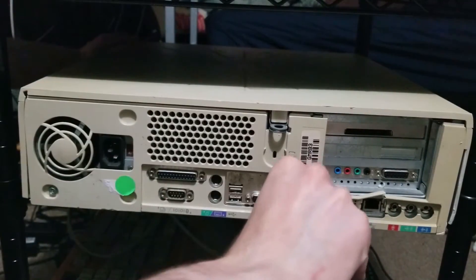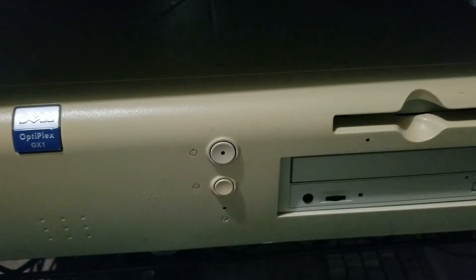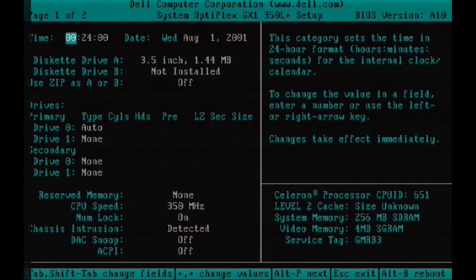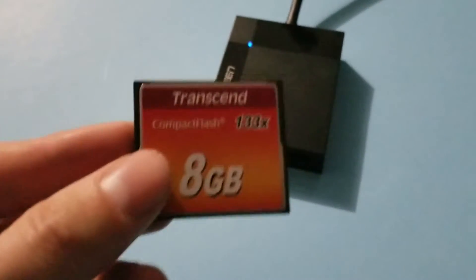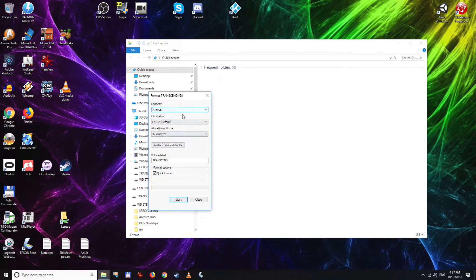Let's plug in all the cables and get this thing going. I'm going to start it up without the card first to check if there are any problems. The clock is still going super fast, but I think that's fine. Let's disable the chassis intrusion alert and also disable the onboard sound as I don't intend to use it. Using a new machine, I'm going to format the CF card and not bother with creating multiple partitions - after all, this is going to be a Windows 98 machine primarily and it can handle large partitions and files.